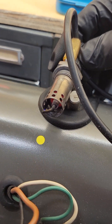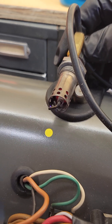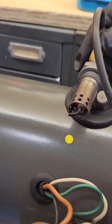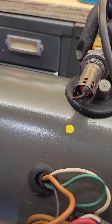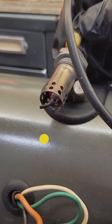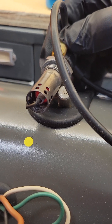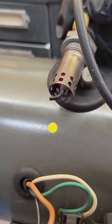Here's a quick look at how these things actually work. The reason why these BN4s are so good and work better than most Eberspächer heaters previous to them is that they have a dual igniting system. You can see the glow plug in the center and the spark plug on the exterior.